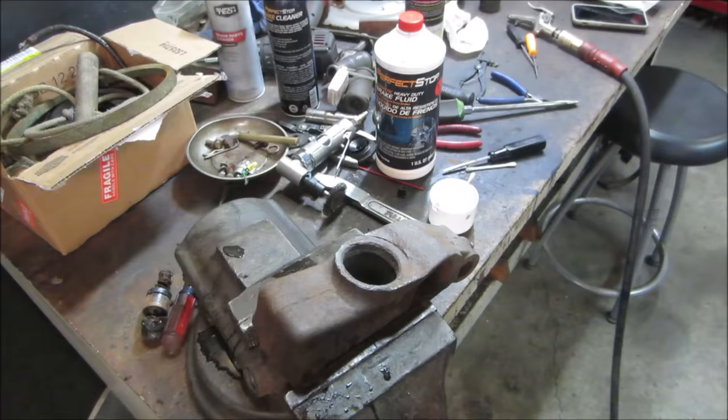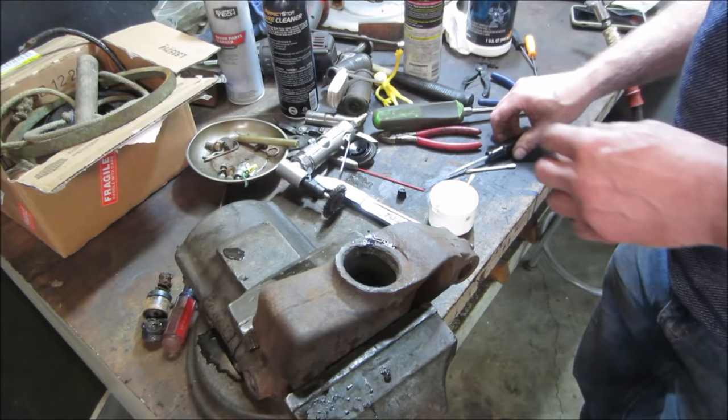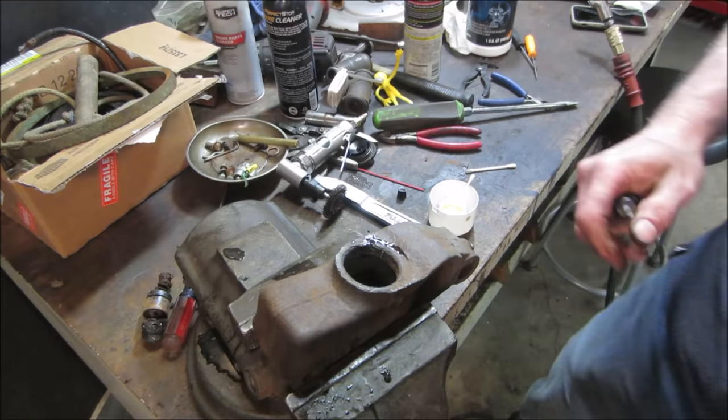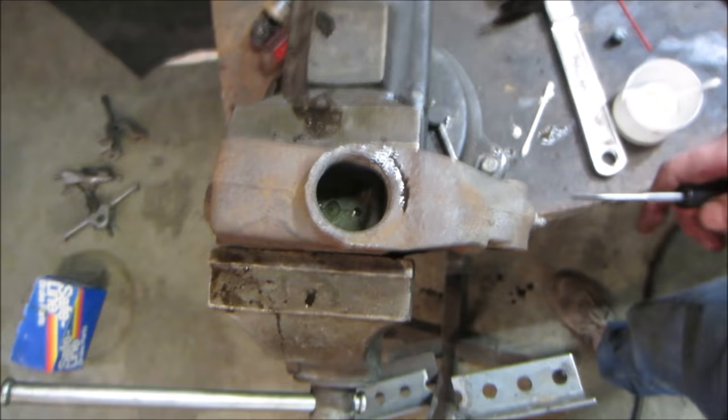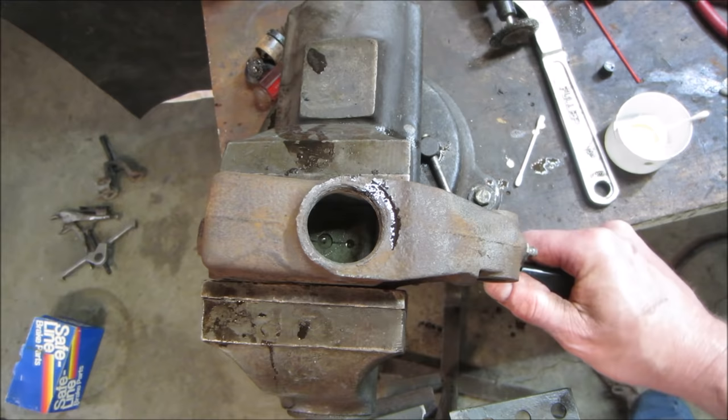Put a little bit of brake fluid in and push it through, but there's nothing in the front resisting it right now. It definitely should just go flubbering at the front. I should probably show you the holes on the inside, huh? What it's doing. See down inside there? You see bubbles come up. That's the air taking the place of the fluid. It should be coming out in the front pretty soon.